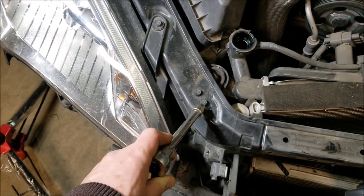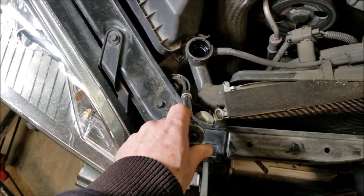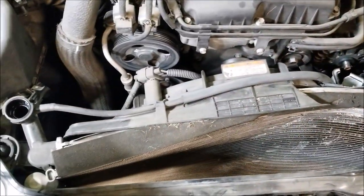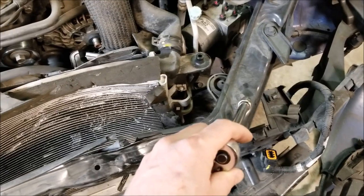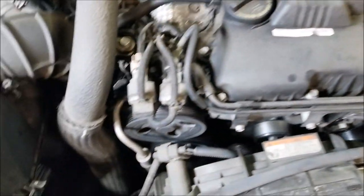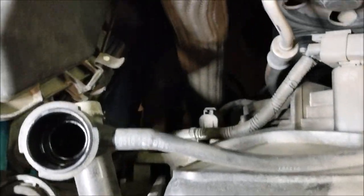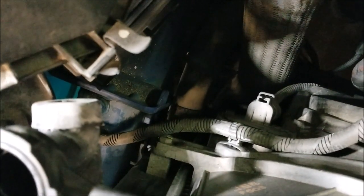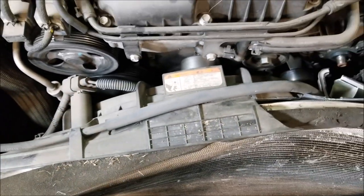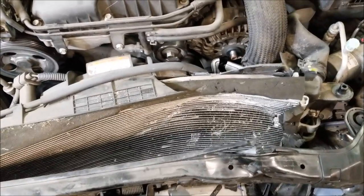From what I can tell, I'm going to undo these two bolts here which hold the bracket. If you look, they're 10 millimeter — you've got two here, two here. Then undo the top coolant hose, and the bottom coolant hose, I think it's on this side — right down there. We're going to undo some of these clips here for the cooling fan, and we'll see if we can get it slid out and assess any more damage that might be there. Looking at the damage, it looks like there's a lot of hair in here — I think they hit an animal of some sort. Don't know how it only did this much damage. It didn't hit the windshield, but the hood is ruined. The other headlight cosmetically looks good, just the tabs broke on it.